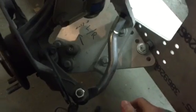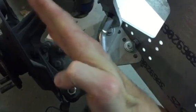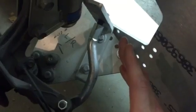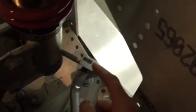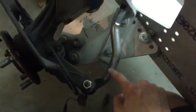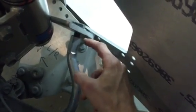To adjust toe on this version — V31 does something different, because this system is kind of crummy. It has bump steer: when the suspension compresses, it changes toe slightly, which is not suspension neutral. But it works, and actually works better than most cars you'd buy on the road right now. This is the steering arm, which in this case is our toe adjust arm. We have a bolt in it and a bracket. To adjust it, you put washers on one side or the other side, and that will adjust toe out or toe in.